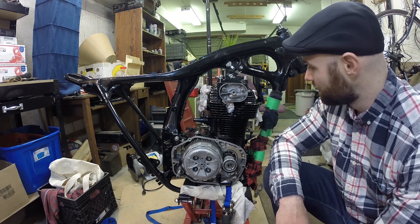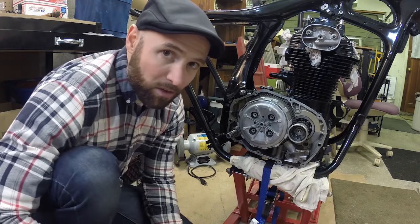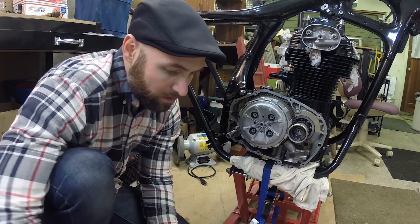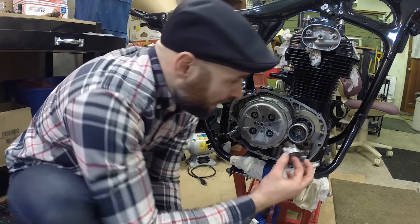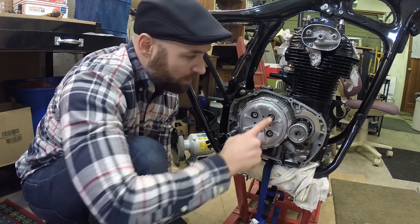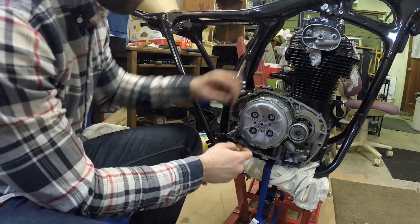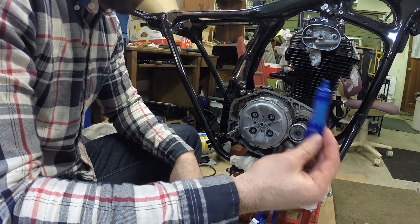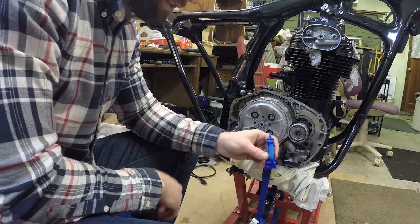Engine in the frame — pretty excited. I still don't know how to bend these locking tabs up inside here. If you have any advice for how to bend these tabs over the lock nut, let me know, because my needle nose pliers just aren't cutting it. I'm going to leave that for now — I'm obviously not going to run the engine for a little while, so that can wait. I'll put the lid on the oil slinger and get these bolts in. I've taken out the bolts on the clutch plate because I was advised to use blue Loctite on them. I put grease before, but I'm going to use the blue Loctite. I didn't do this before because I didn't have this inch-pound torque wrench, but now I can get it to six foot-pounds. Jeff advised that six foot-pounds should be good.